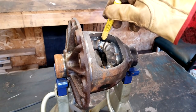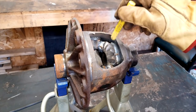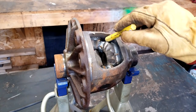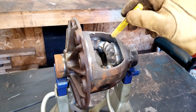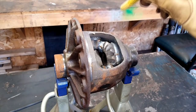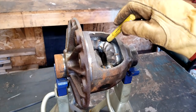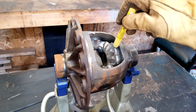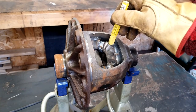A couple things to remember when you're welding these up: I like to make sure I've got good penetration in the gears — I like to try to go through the gears all the way back to the other side. I like to make sure I have a good weld between the gear and the carrier, and I normally even like to come in and fill in the gaps that are open between gears and carriers. It's a big gap to fill, but if you turn your wire up a little bit and you've got a good welder, you can probably knock it out pretty fast. If you don't have a good solid welder, try to find a friend that does. I normally don't like to use a little 110 welder for this type of work because I don't think they get good enough penetration. Once you've welded these up, this carrier is no longer good for anything else — it's committed to being a Lincoln Locker.